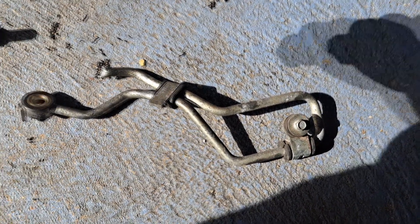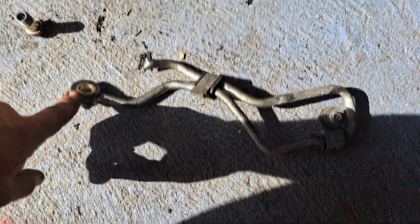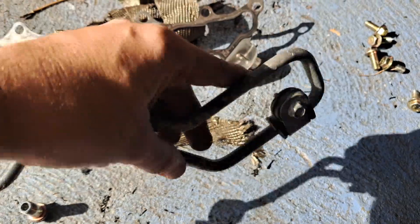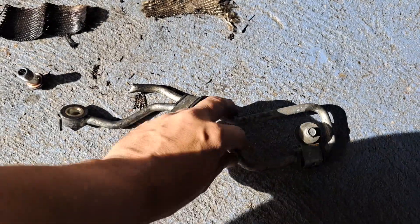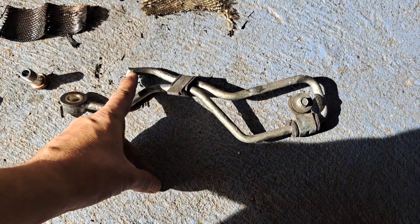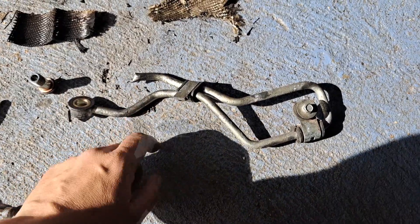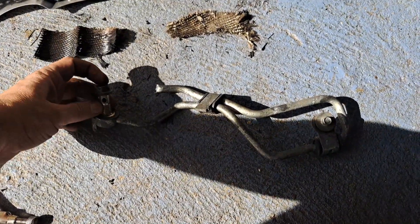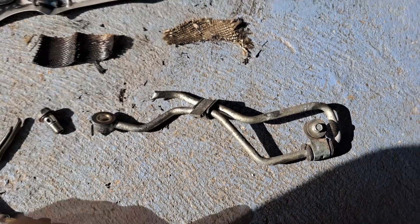This bit was from the new rack where they've cut it. Basically this one goes onto the steering rack and then there's a little bolt here. What I'm going to try and do is use the one that's already on the car so I don't have to mess about with it. This one goes right to the top of the power steering pump on the front of the engine, which is a bit of a pain. So on the old rack I'm going to undo this little 10mm bolt and this banjo-type bolt and get the rack out separately from that.